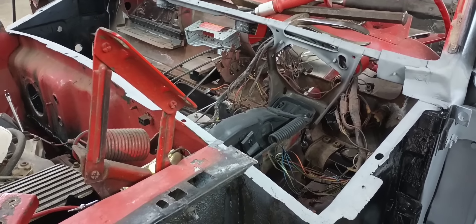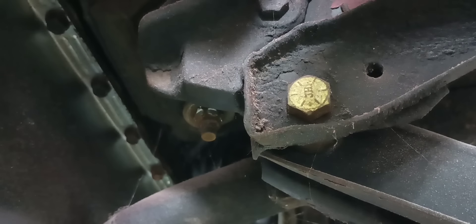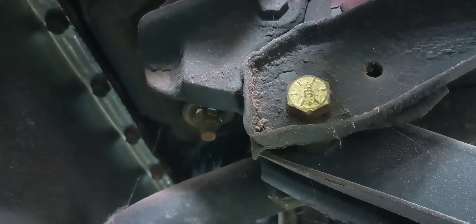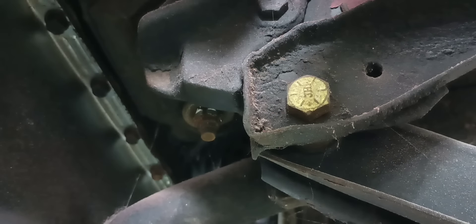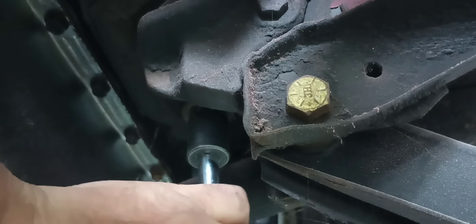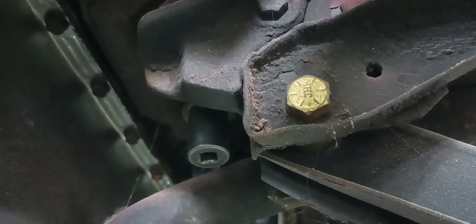This thing is definitely going to have to have a nut-and-bolt check over every part of the car once it's back together. I went down here to try to get the motor mount bolts loose, and this one right here was already kind of shiny — which stinks all in its own — and it's stripped. My deep-well extractors — I don't have one big enough. So I'm going to try to hammer a metric socket on this thing and hopefully it'll come out.